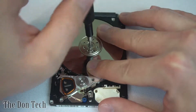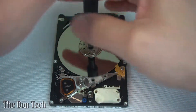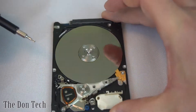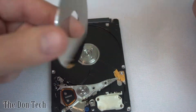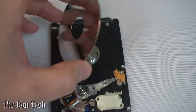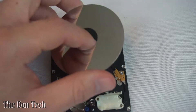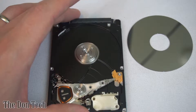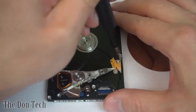I have to put a little pressure on the actual platter part itself. Once you remove this final screw, you'll be able to get the platters out of the hard drive. Depending on the size of your drive — both physically and in gigabytes — that will determine how many platters you would have. This one only has one platter, but it's not uncommon for laptop drives to have two. These platters are made of glass, so you want to handle them delicately — if you try to bend them, they will shatter. The desktop ones will actually bend before they break.